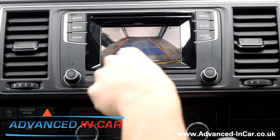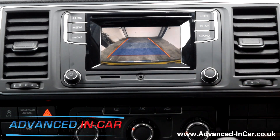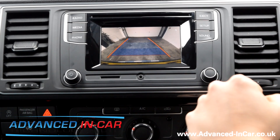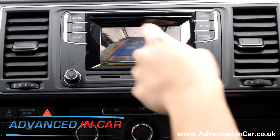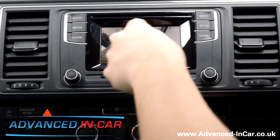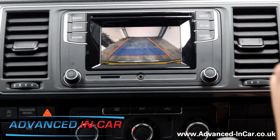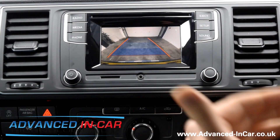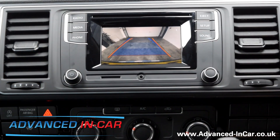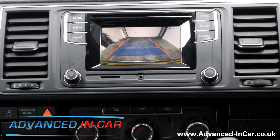For obvious reasons, the guidelines aren't going to be the same width as your vehicle — it is an aftermarket kit, but it is designed to look and feel like a factory piece. Picture quality and resolution is really awesome; it's using an NTSC camera and it looks and feels amazing. Depending on the vehicle, you can have the PDC function come up on the left or right hand side, but whether or not it's going to allow that functionality to work correctly depends on the car — you'd never know until installation. So in some instances we can activate it fine; in others the car just won't support it, so we turn it off. When you turn the steering wheel left, your guidelines move accordingly — and remember, this is an aftermarket camera giving this functionality, which is pretty awesome.